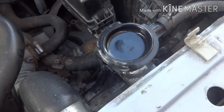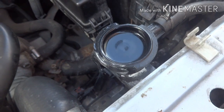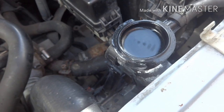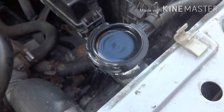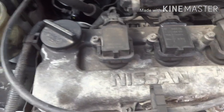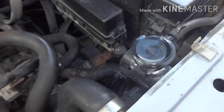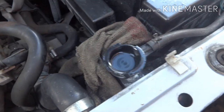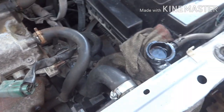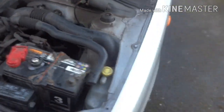It's been about two weeks since shooting the final part of this video. The car's been in pretty much daily use, only short trips. Still getting a certain amount of bubbles out of the top of the radiator, but the engine's still running. There's no residue formed in the top of the oil filler cap and nothing on the dipstick. It is still pushing some air out. I have had to top the radiator up a couple of times during those two weeks - only about a quarter of a liter of coolant, but roughly two or three times.